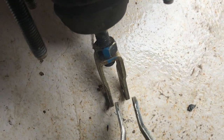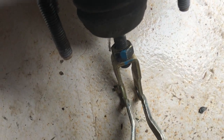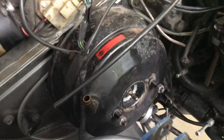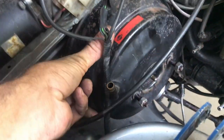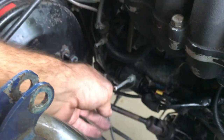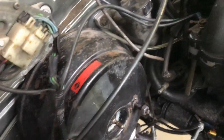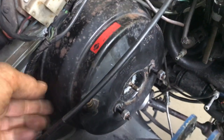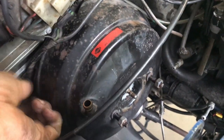The connections to the pedal are slightly different in shape but pretty much the same width, which is good. I'll check the pin size, make sure there's no gasket on the firewall, then pull the old master off and throw this one in. It looks like it'll be a straight bolt-on affair. Just be nice and careful putting it in and it slots right down in there. Just got to throw some bolts on the inside, the master on the outside, and reroute the brake lines that Luke did the other day. Make sure you don't pinch any wires.